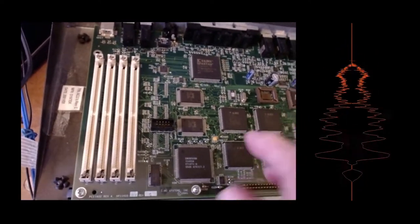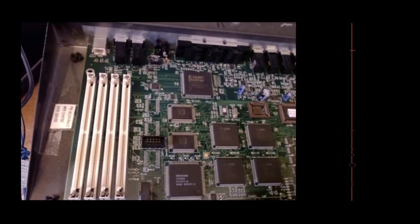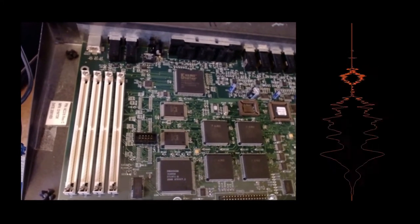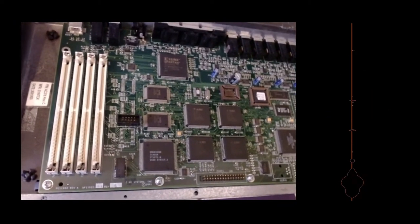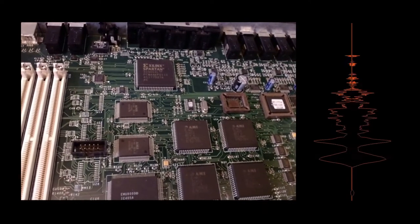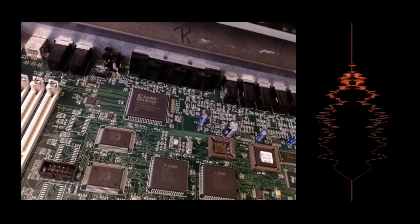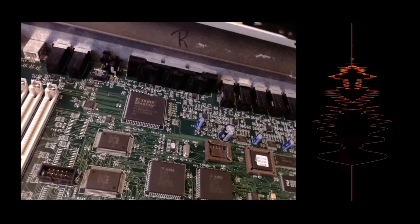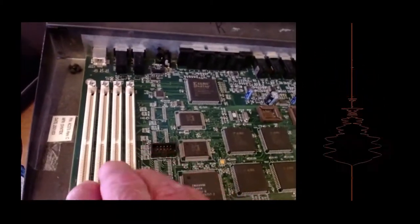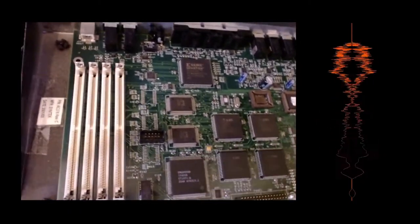I think what I'd done is I'd made a preset sound using two or three ROMs, and taken one of the ROMs out to put into my Proteus 2000, and the sound no longer works, and I got an error with not installed. So I appreciate that John pulled me up on that and said, no, hang on, that's not quite right, that any ROMs in any slots, as long as you have all the ROMs in the slots that made the preset sound, then it'll work. So that's another thing.